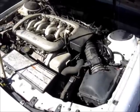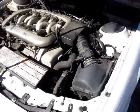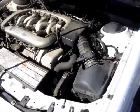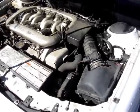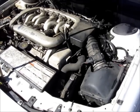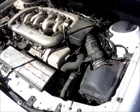A few words of caution if you plan on attempting this procedure. First, water can destroy an engine. If you put too much water into the intake manifold, it will lock up the piston and it will bend rods or blow head gaskets or all kinds of nasty stuff, because water does not compress. If you get too much water between the piston and the top of the cylinder, damage will happen.